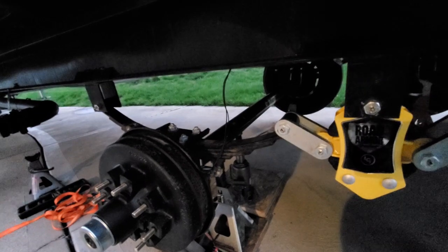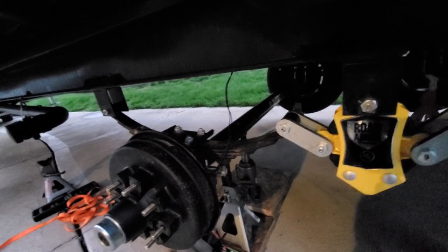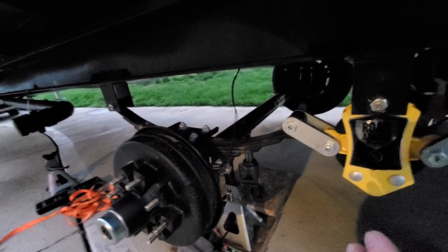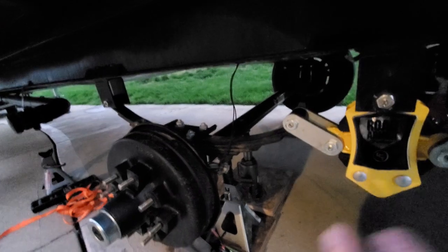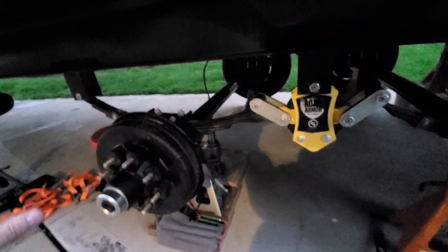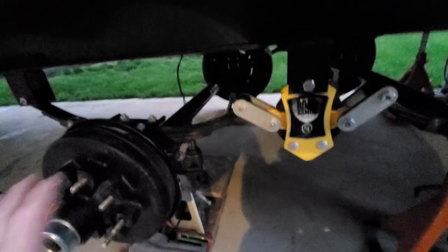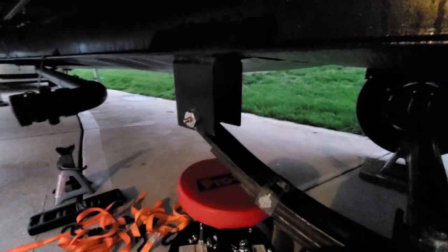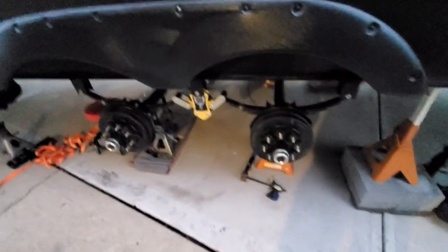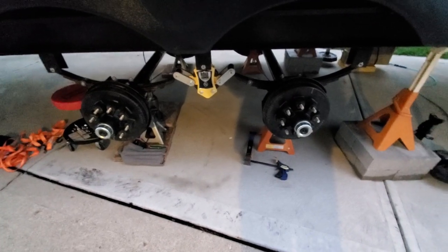How much more could it cost on the rig? Another $20 to get springs with good bushings or never-fail bushings in the spring shackles? It's sometimes absolutely asinine where they want to cut a dollar. Your investment is riding on these axles and they put the cheapest thing in here they possibly can. There's the front shackle hanger — we put a new bronze bushing in there and the wet bolt. Tomorrow I'll get the wheels back on this side, then remove the right side suspension and do the exact same thing.